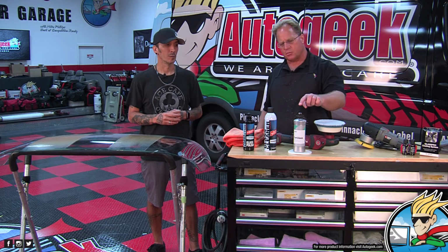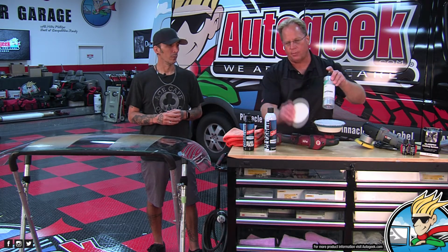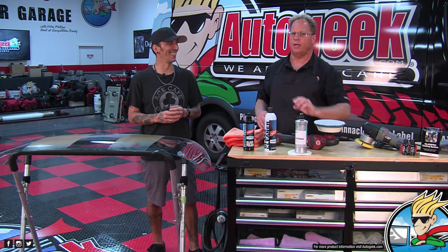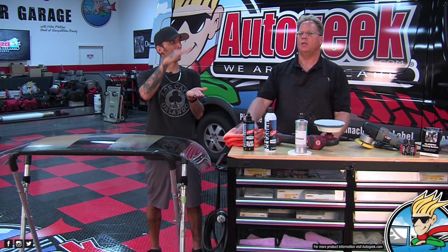We've shot about three different videos on subsurface glass polishing, where you're using cerium oxide and a rayon pad and working it for hours. But this is totally different. This is just topical glass polishing. This is a film on the surface, the stuff that sits on top. In the comments on our subsurface video, people said you could just take a regular compound and remove that. No, that isn't going to work, because in subsurface polishing we're actually leveling the glass, whereas here we're removing what's sitting on top of the glass.